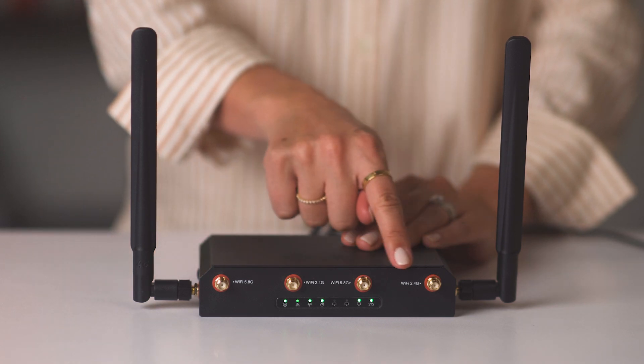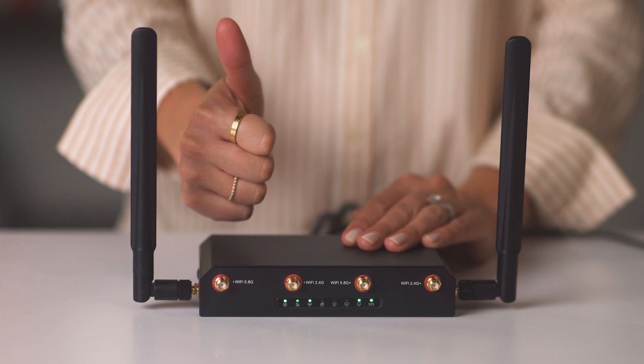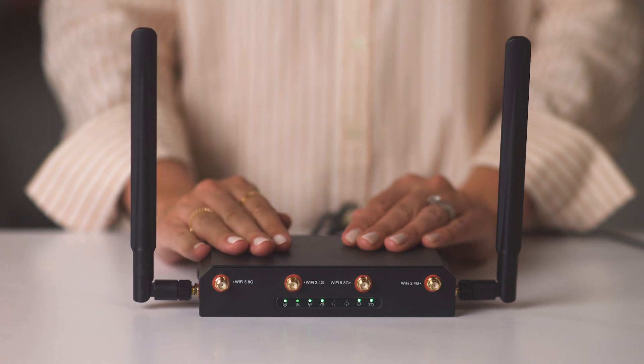If you are still unable to see the lights on the router or internet modem's respective ports, try contacting your internet service provider to further troubleshoot your internet modem, as this is likely the issue. If your internet provider can confirm that a hardwired connection is flowing from your internet modem, contact our customer care team to further troubleshoot your Toast router. If your Toast router is showing solid green, that means there is a working internet connection between your internet modem and your Toast router, and it's time to look at the connection between your Toast router and your Toast switch.